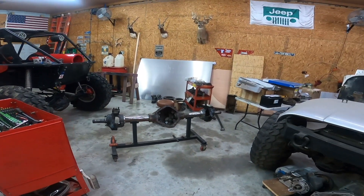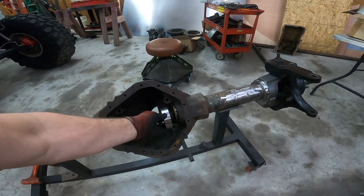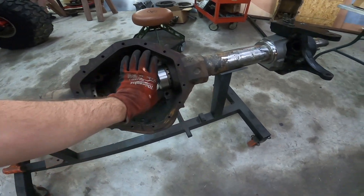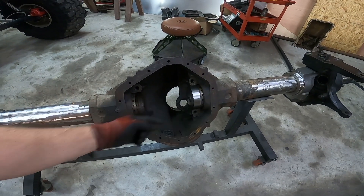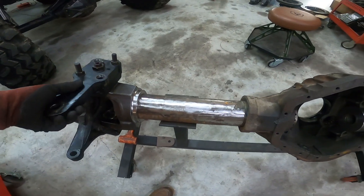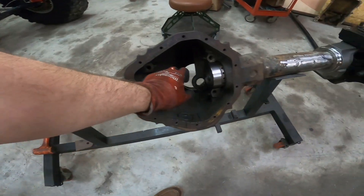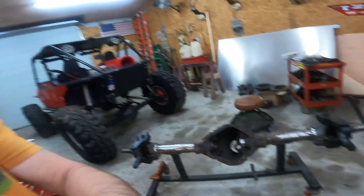Okay, there's the axle. If you didn't understand what I was talking about, I'm going to take these little pucks and put them right there where the race goes, and I'll bolt them in. That piece of DOM will slide through there, and as I weld the inner C's — see they're not welded on, you can spin them — as I weld those inner C's on, I'll make sure I can turn that DOM running through there to ensure that everything is straight and true. So I'm going to get this all set up and break the welder out.